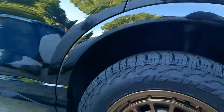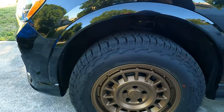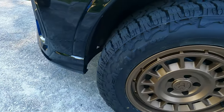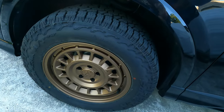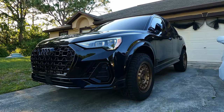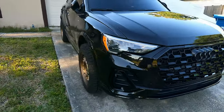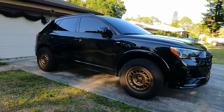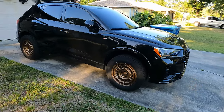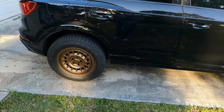You can see the wheel gap — plenty of room there — and the wheels look awesome. In the front, same thing, lots of space, a little bit less on the backside. I don't think a bigger tire would fit; you could probably go 245 versus 235, but my friend has 245s and they rub on the inner rear liner — though his offset might be different than mine, so take it with a grain of salt. The car is comfortable now that it has integrated its tune and has a little bit more power. I do need to see if I can recalibrate for the slightly bigger wheels and tires, but overall the speedometer is pretty good — off by about one mile per hour.